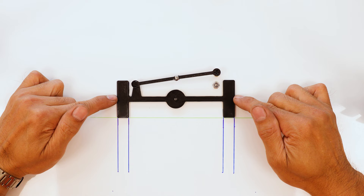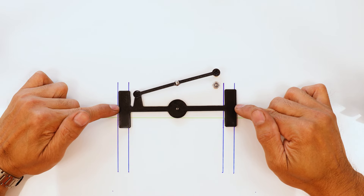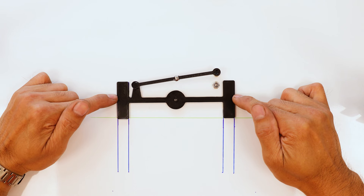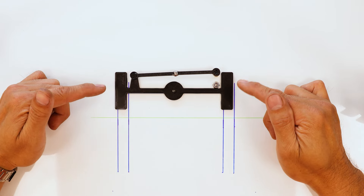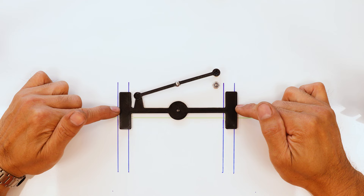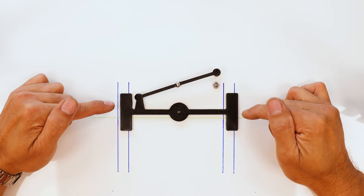However, have we solved the problem of the lateral movement — the excessive lateral movement? Because this is not the optimal geometry. In the compressed upward axle position we still have this lateral movement, and more so when we go down. If you've got long travel suspension in the back, this will be even more exaggerated. So is there a better solution?